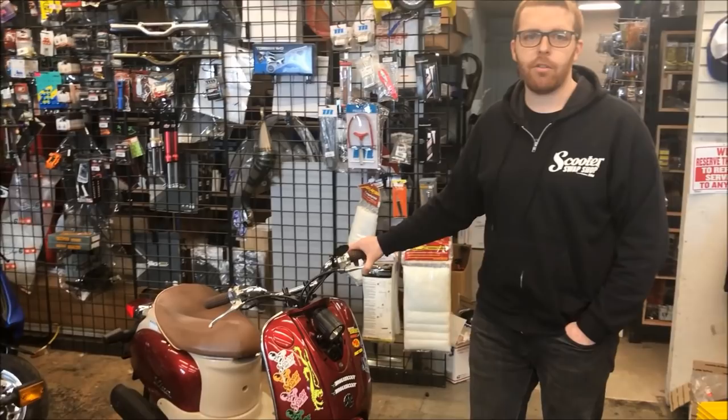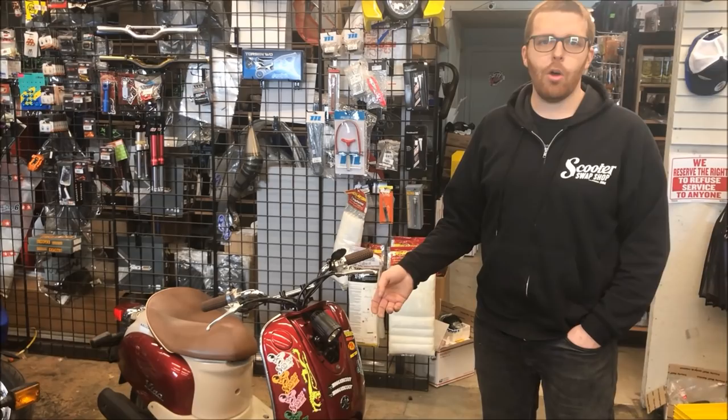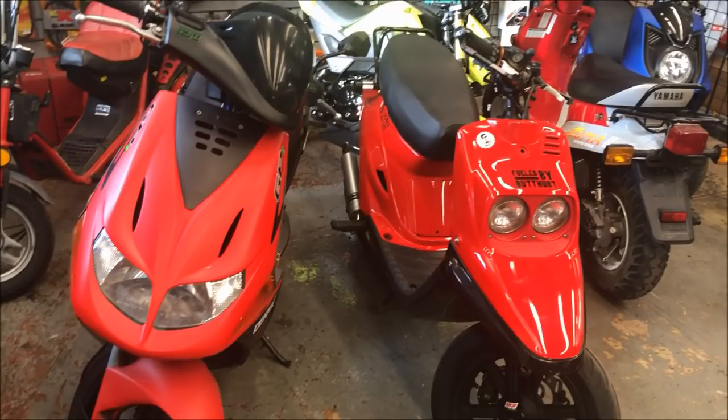If you have gears, it sort of kills your under 5 or 10 mile an hour, depending on your gears, because your transmission is already in its lowest gear. Whereas my lowest gear on this bike, I can creep along doing wheelies at like 1 mile an hour and it still has variator at that speed. So that's another thing to consider too. If you're not concerned about having a bike that goes 50 plus, definitely keep stock gears for wheelies.